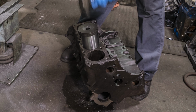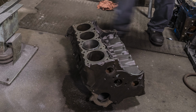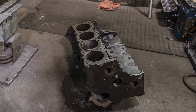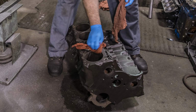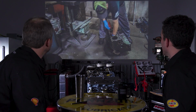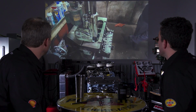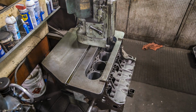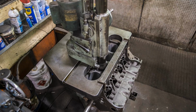And like you said, there is no Loctite, there is no sealer from that function, because the press fit seals it all the way around if it's a good concentric hole. And you're going to have the seal that you're looking for, as far as oil and water and compression. So back on to the machine, and at this point now, here he's going through and boring the rest of the cylinders, because it's like, okay, that hole is good, it's salvageable. Now we can bore everything and be done.